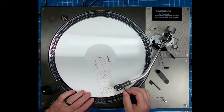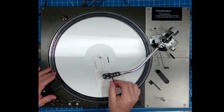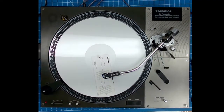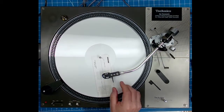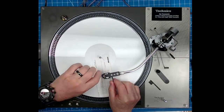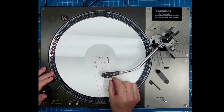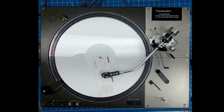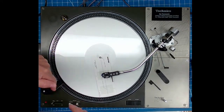Let's start over here in position A. You place your tone arm, and be careful because the stylus has to be out. You have to hit that precisely. Let me move this up. Okay, so you place the stylus exactly on that little dot there, and then you look straight down, and if everything's lined up right, then it should sit equally spaced between the lines and perfectly parallel.